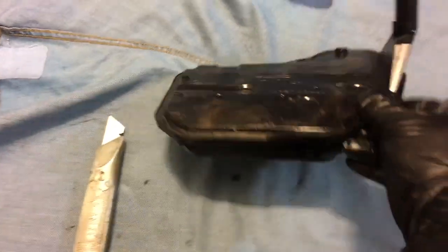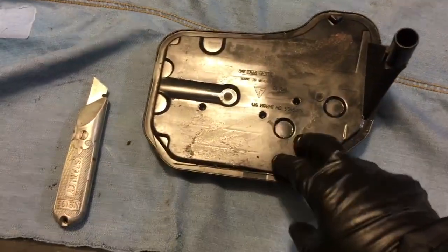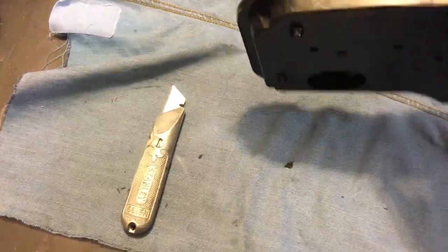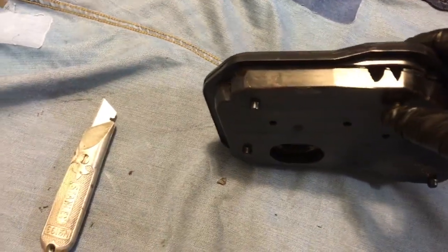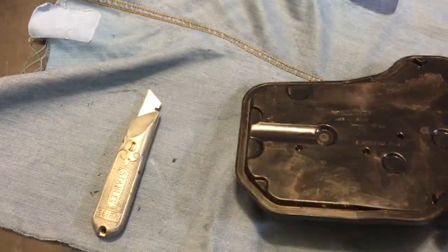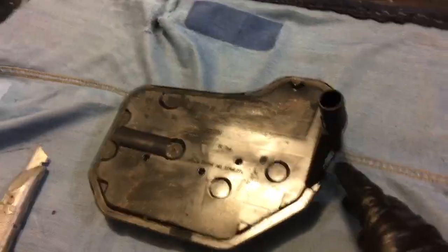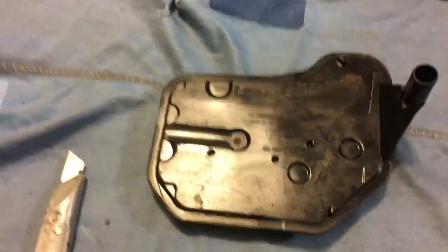I took the knife to the bottom ridge. It's a hard plastic but also a brittle one, and it's quite thin, so once you get a score mark in it, it cracks very easily. Keep in mind: treat these filters daintily during installation — don't be hammering or prying on them, particularly the snorkel. Any crack in that area will cause pump starvation and serious problems.